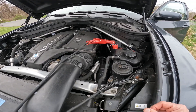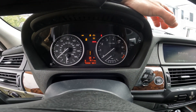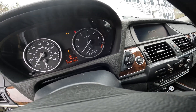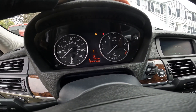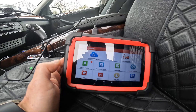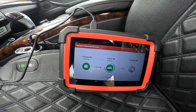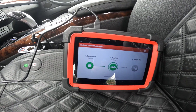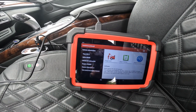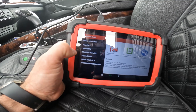If you don't have a battery charger, just watch your battery voltage so it doesn't get too low. I'll start by turning the ignition on — all the instrument cluster lights usually come on. On some newer cars you do a triple press of the start-stop button, but on my BMW X5 I only press it once. Now let's try the intelligent diagnose — you have to register the product before you can use that. We'll select BMW, not EV.